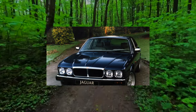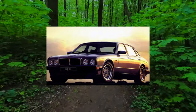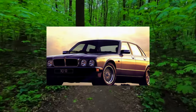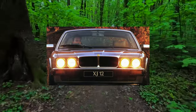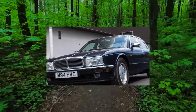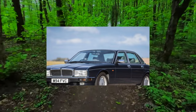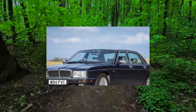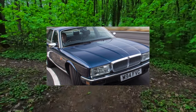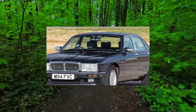Not very reliable radiator and heater fans, an intercooler pump, and a gasoline pump are not super problems for a normal owner. The car has good foolproofing — even a powerful XJR can drive for a long time without an intercooler and with one interior fan. But if you save too much, Jaguar will stop. Spare parts prices are strangely high in our country, although in Europe there has always been a choice of non-original parts and restoration services. With current spare parts availability the situation has become much worse, though old stocks help out. The wiring is done without unnecessary difficulties and with high quality — the main thing is to listen and check what is still working and whether it is time to think about replacement.